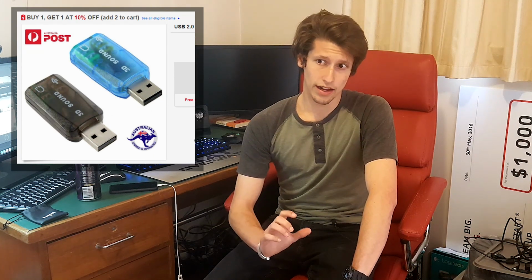I did get Voodoo HDA on there, but that sort of annoyed me because the way that that loads, you would hear a hissing and a humming, and configuring it's not that easy. So I ended up getting a $2 USB to sound card adapter on eBay. It's just a small blue card. I'll put up an image. Plug that in, and it was natively supported, so I didn't need to play around with it anymore. No hums, no nothing, but audio plays instantly, which is great.